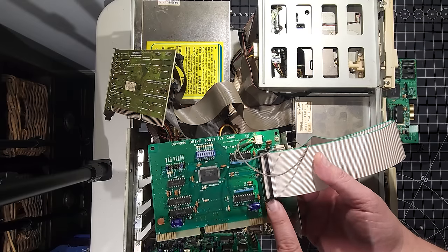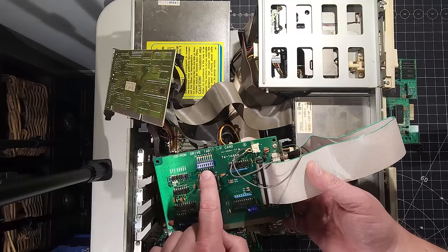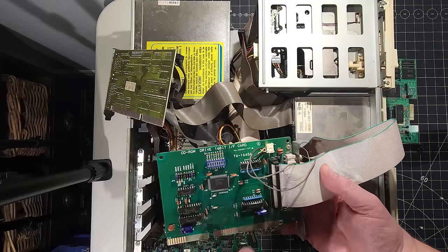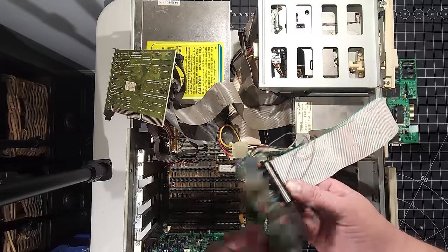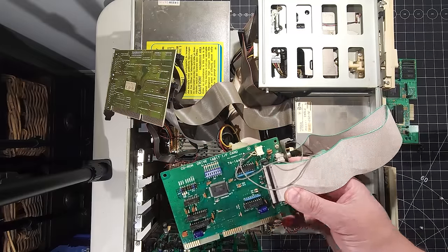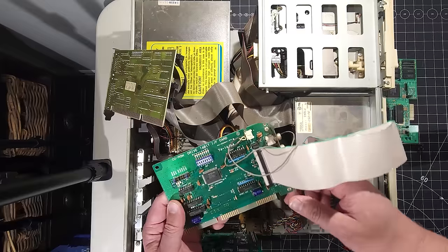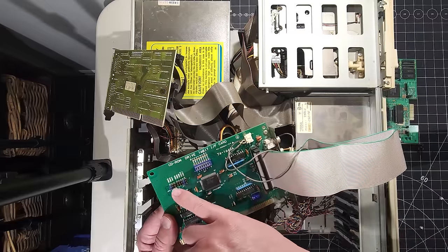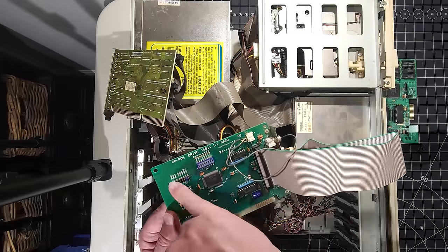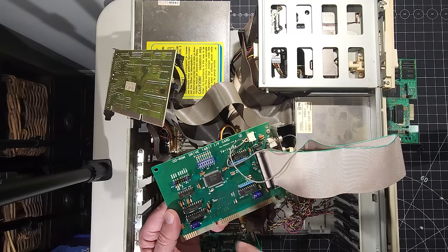So here is the IDE port, but then you have some jumpers here. So I imagine these jumpers would allow you to switch between functionality. I'm just looking at it here. Nope. So it does say Mitsumi on the chipset. So it's probably a Mitsumi drive as well. So here we have different DMA settings that are selected. Do we have IRQ? Yeah, so DMA and IRQ. So it's all in that same area.